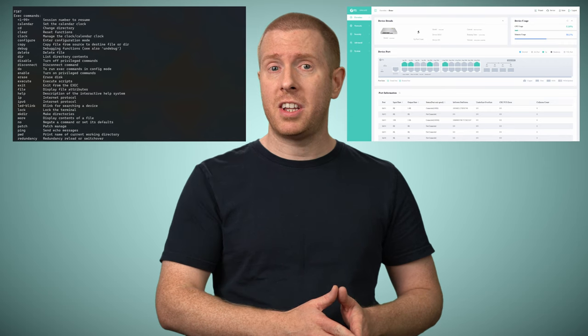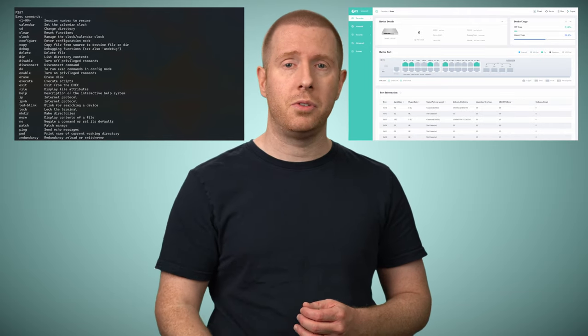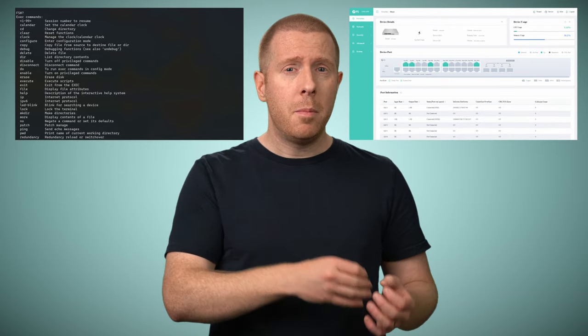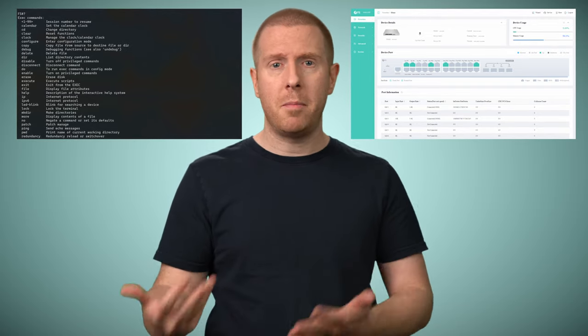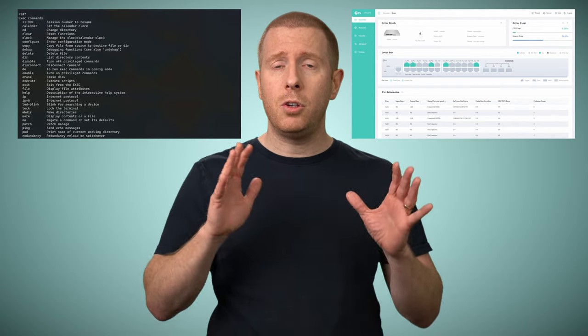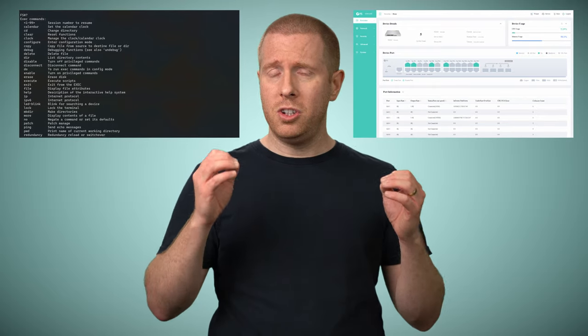I'm not going to do a bunch of performance testing on the switch — I'll put a link to the IXIA report in the video description if you want to see the latency and throughput numbers. Instead, let's take a look at the management side of things and how you could start learning with it. There are two ways of managing the switch: the web interface and the command line. The web interface is accessible using HTTP or HTTPS, and the command line is accessible using SSH, Telnet, or a console cable. The web interface is an easier learning curve, but it only gives you access to a subset of the features — it's like using the switch as a souped-up smart managed switch. For ultimate control, you'll need the command line.